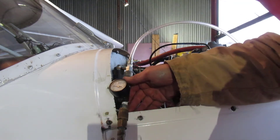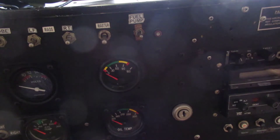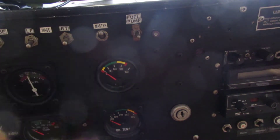The next step is to spin the propeller until you get oil pressure. I'll turn the pressure on and spin the prop. Rotax says somewhere between 20 and 60 times — I'll probably do about 30 to 40 revs. They say to spin it until the first indication of oil pressure is seen, but being by myself I can't see the gauge. So I've got the camera there — that's the oil pressure gauge. You guys tell me as soon as it comes up.